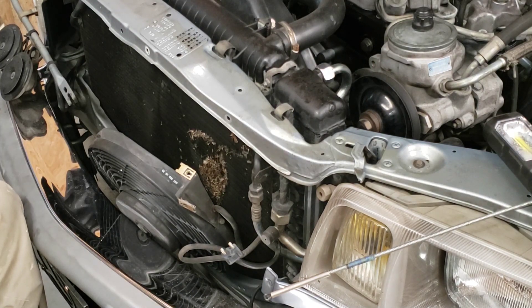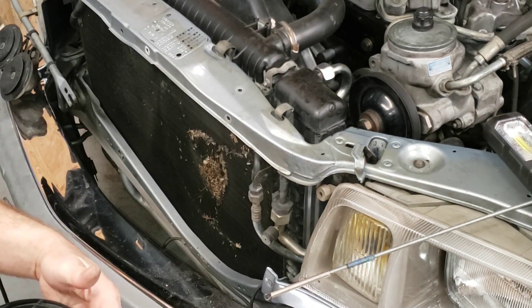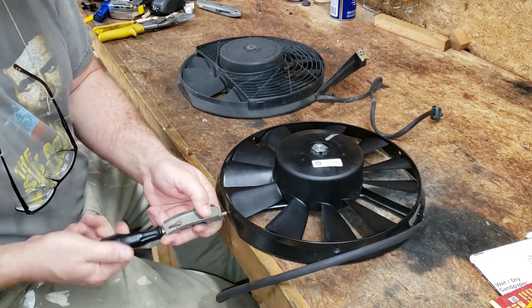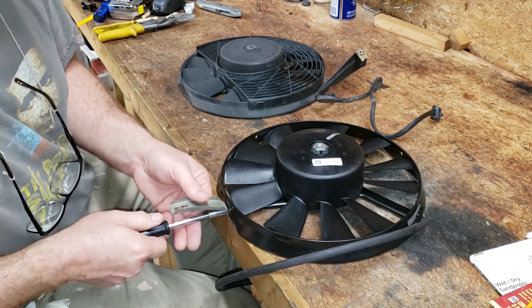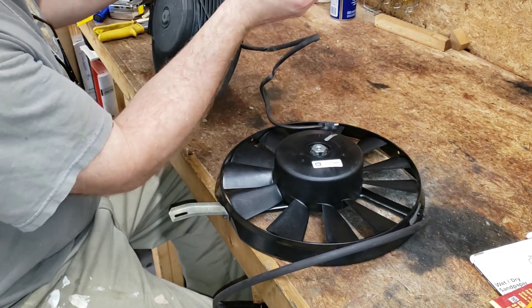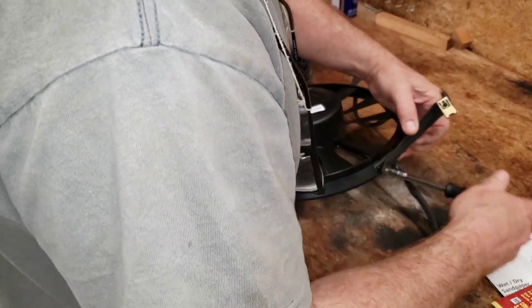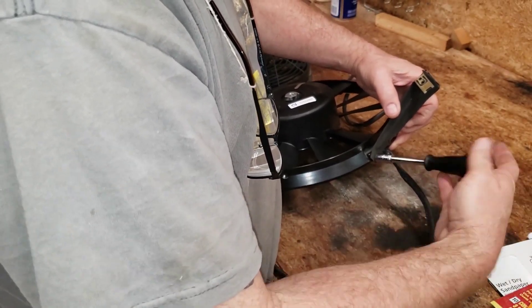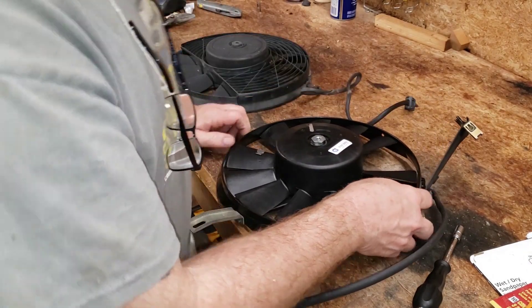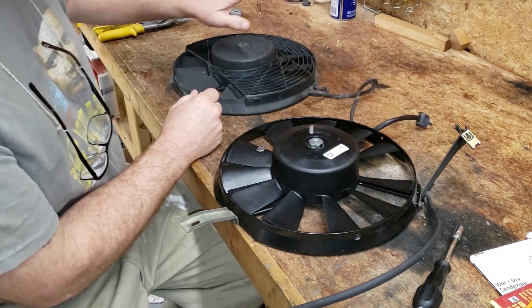We're going to let the horns dangle over there. We are free, ladies and gentlemen! Let's take this over to the bench and transfer the bracketry, the fan shroud, and all that stuff. It's not too crucial about the orientation — it just needs to be straight; you've always got a little wiggle room. Let's do the top one here next. You don't want to get this one too tight because you need a little flexibility to get everything positioned — just snug it up a bit. That's all the brackets that need to be transferred. Let's take this little shroud off next.